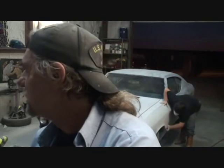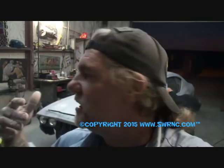All right, how y'all doing out there? This is Pete over at DIY Auto School. Now we're working on our muscle car makeover. And where we left off, we had to prime the car. We block sanded the whole car out. I went over it with the DA sander. I got all the deep scratches out. I reprimed the whole car. And now what we're doing, we're actually blocking the car.